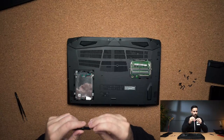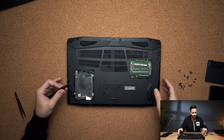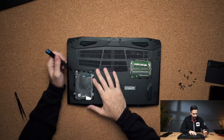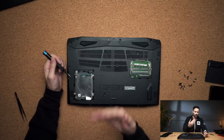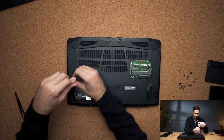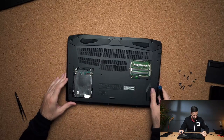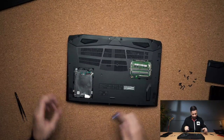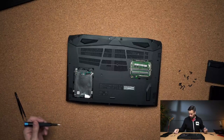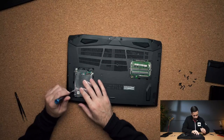Is there any problem if you undervolt your CPU? No, there's no problems if you undervolt your CPU. Just, you have to play around with it. If it's undervolted too much, your system will shut down. And obviously, if it's undervolted too much and not enough power is going to the CPU, you have the potential of instability. And of course, you can expect things like crashes and system failures. So you have to play with it and see what's right for your CPU. There's no correct answer. Every CPU is a little bit different. Depends on the silicon inside. Did you win the silicon lottery? Things like that. So you have to play around with it.